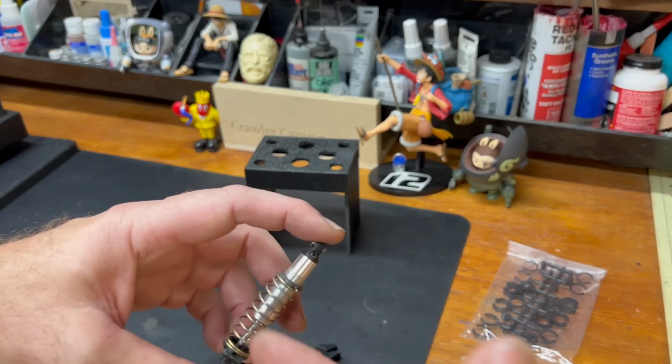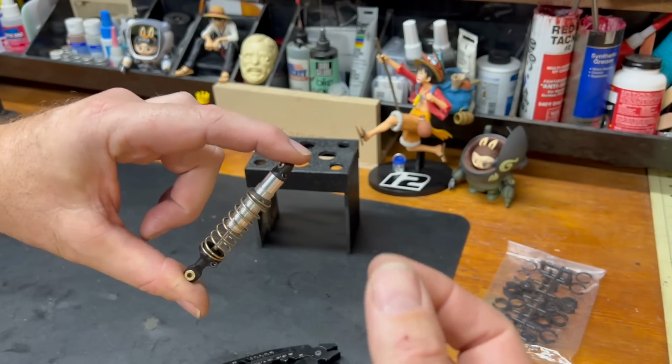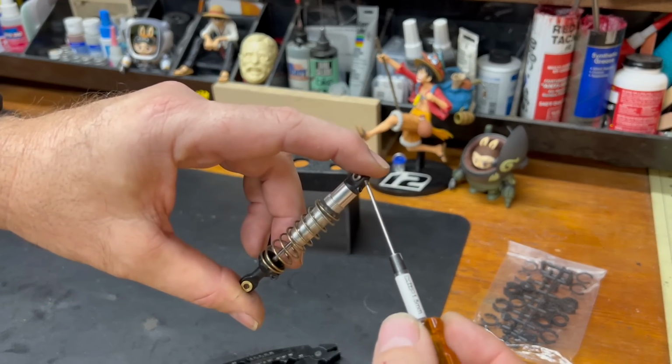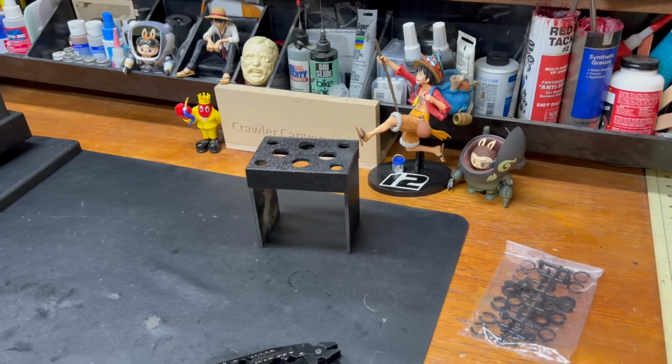You fill it with oil. You can fill it all the way up. This screw is out. You thread the cap all the way down. You've got your driver or your wrench, and this guy sitting over here with this screw on the end of it. You go whoop, and you dial the screw in, and you're done. That's how you build a shock with a bleeder screw on it.